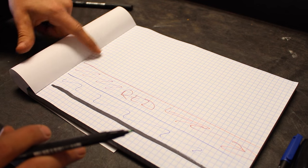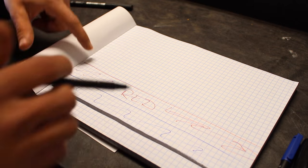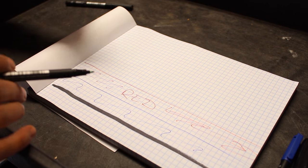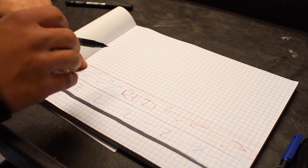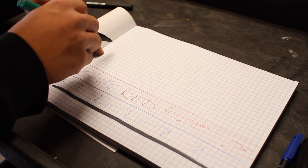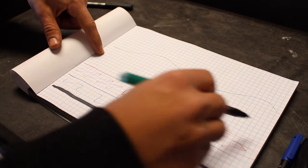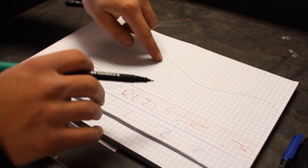The way they spray this down is going to be with a paint gun. And because it's very thin, because it's not perfectly smooth, when you spray it, you might have orange peel or texture when you're spraying it. And you're gonna have that for every single one of these layers, but it's only evident for the clear coat. So say this is the clear coat, pretend this is very zoomed in. So this is essentially your texture.